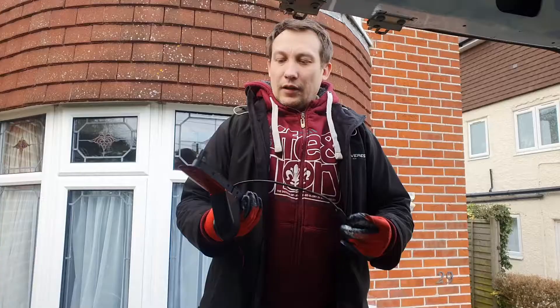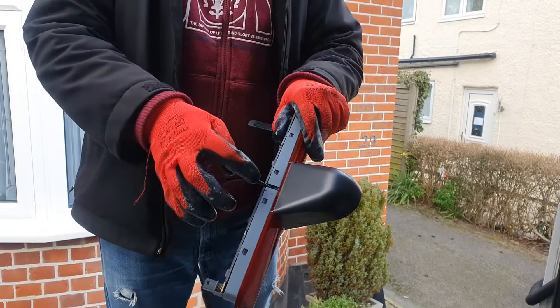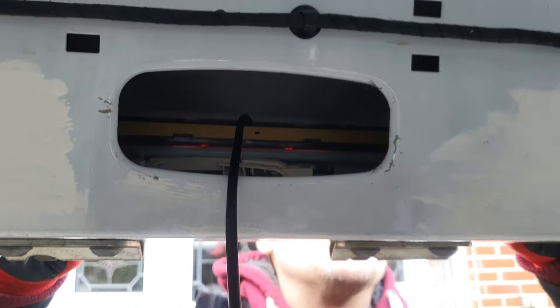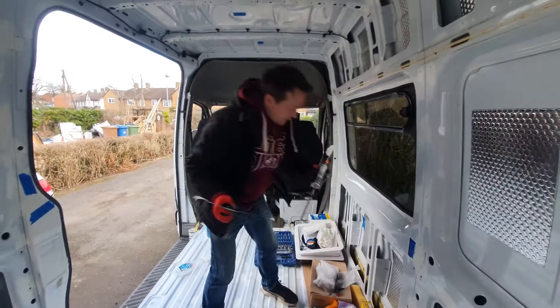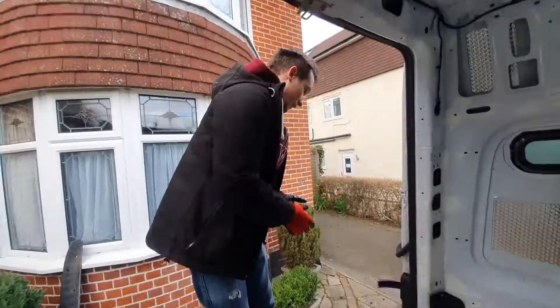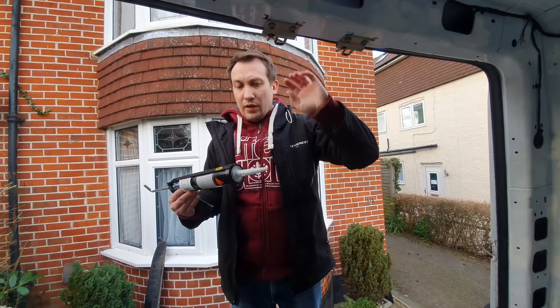As you can see, the LED strip is in — it was a real fuss to get it in there because of the wire. What I had to do is drill a pilot hole, just missing the LED light bar strip. Let's test fit it and see if it fits. I'm going to put the double-sided tape on the car first, then take a little bit of Sikaflex and just work around it to make sure there's no water coming in — put a small bead of Sikaflex for extra protection, then stick the light on.